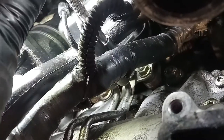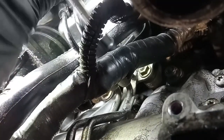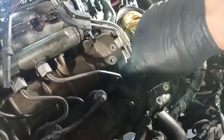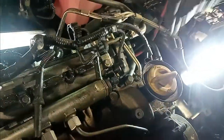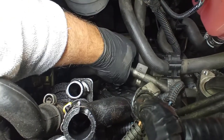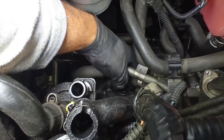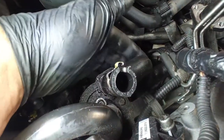One more screw over here holds down the vacuum lines. Just remove it. Pull up the vacuum lines. While you are pushing out the metal pipes like this, take out the vacuum box. Best to take this breather hose to the side to make more room.